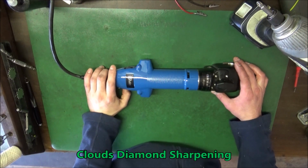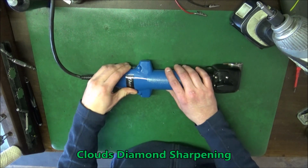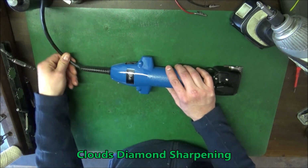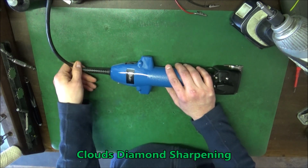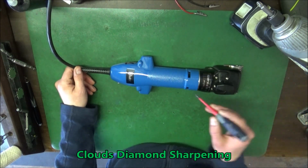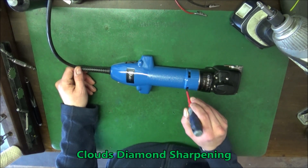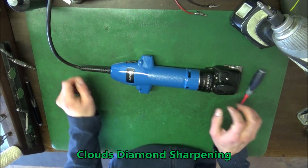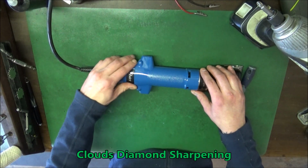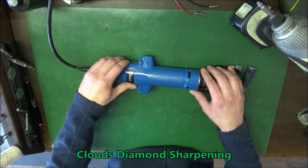So this is a cattle clipper. We're gonna diagnose it so it does not come on. The cord is bad, most likely. It looks pretty kinked. It could be the cord. It might be the armature. We could check the armature. If it doesn't turn on, then it's probably not the armature. So that's good. It's not the switch. I mean, it could be the switch, but we'll find out. Let's take it apart.